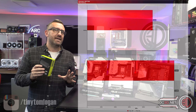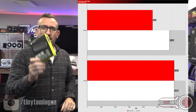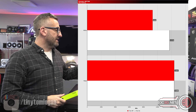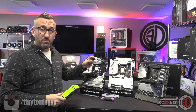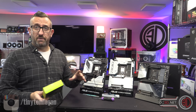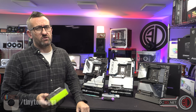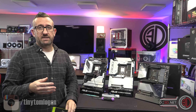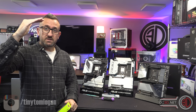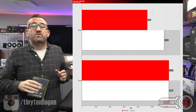It gets to about 78 or 80 degrees before it starts to throttle. The only way I could achieve that was by not attaching the SATA cable that came with it to drive the fan — basically disabling the cooling entirely. I did have to really hurt it to get there. It did reach 80 degrees and then write speeds started to plummet, dropping back down to PCI Express 4 levels.